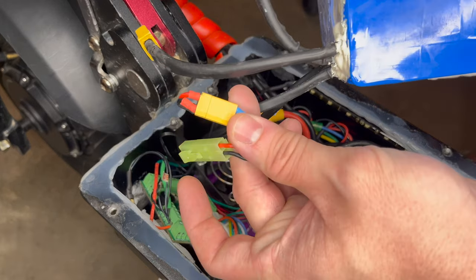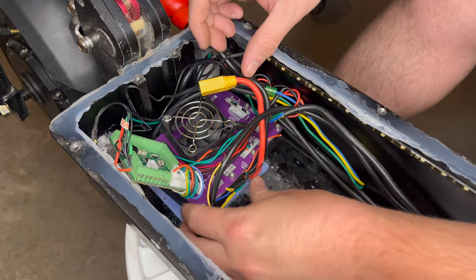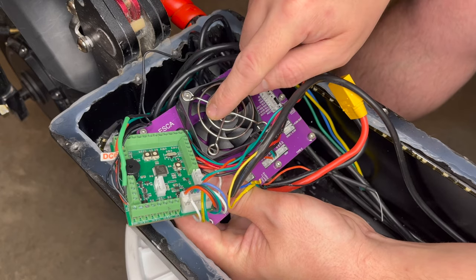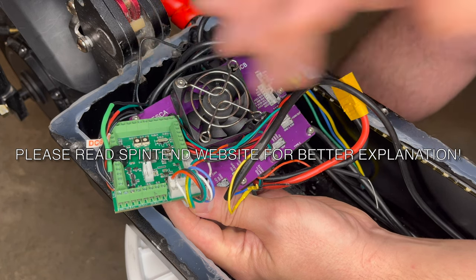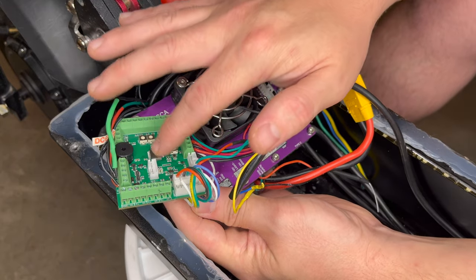You can see there's a bit of a wire mess going on here, but honestly all scooters have a lot of wires and that's only going to get worse as more components get added. That's something you'll just have to learn — look at your scooter from the components and see how they're wired together if you're going to be modding scooters. The basics of this build have three components: the u-box, this fan, and this — called the ADC controller. It interfaces with your throttle up top and converts 5 volt to 3.3 volt. Spintend gives a lot of information about these on their website.